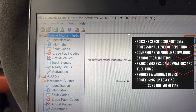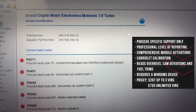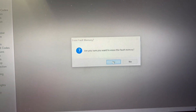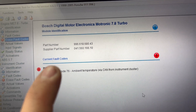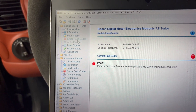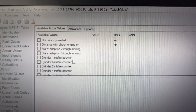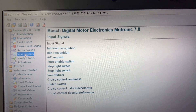It all depends on what you need the tool to do. If you are an active Porsche mechanic, you probably cannot live without this tool or something similar. For the average do-it-yourselfer, all the other tools I've presented would certainly meet your requirements. But if you need to deep-dive into very specific Porsche data — like over-revs, cam deviations, and fuel trims — then this is the tool for you. It's presented in a very familiar format resembling Windows File Explorer or an MMC snap-in, so it's easy to navigate. The only drawback is that it requires a Windows device and does not support macOS.